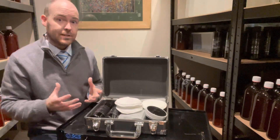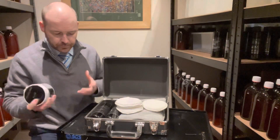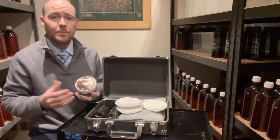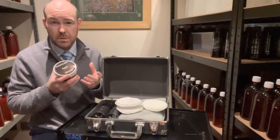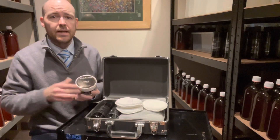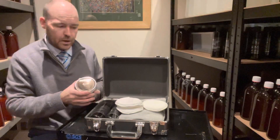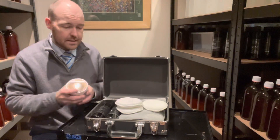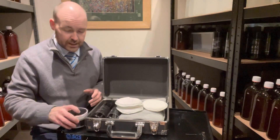So let's see what's inside the kit. First off you've got your 200ml wax — there's quite a choice here. This customer opted for Anvil as they've got metallic paint. Anvil is particularly good on metallic paint; it allows that flake to come through because it's a high-clarity wax, really giving you that nice sparkly presentation.